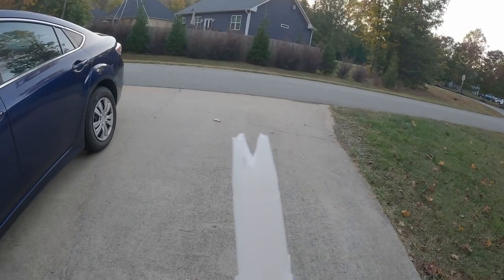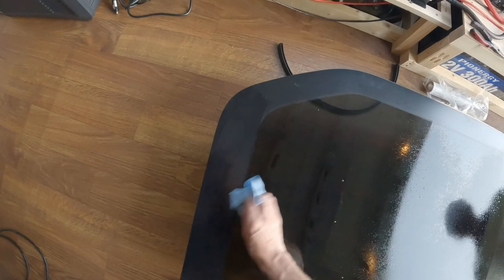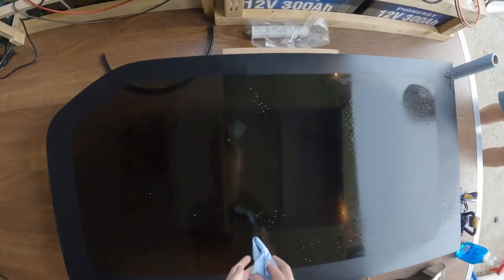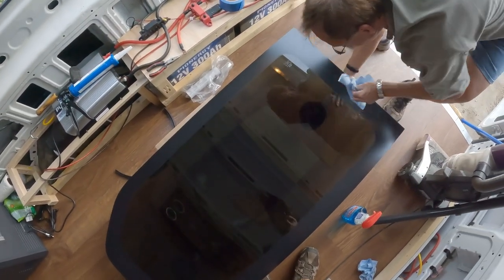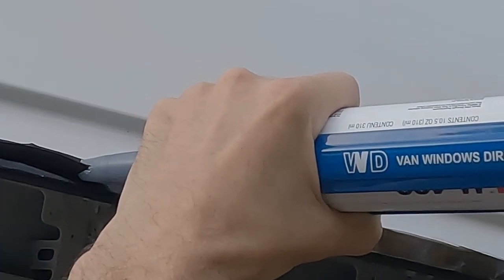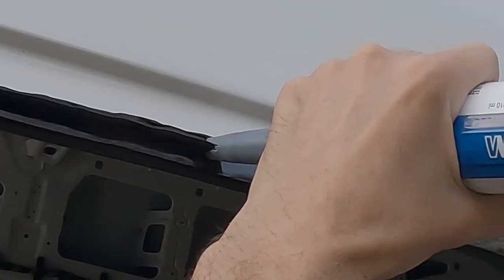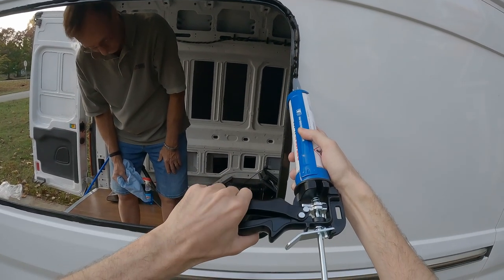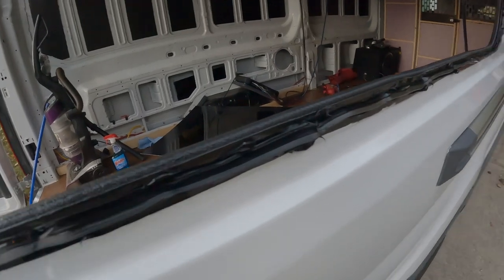With your bottle of urethane, cut the nozzle to look like this — it will come out properly and in the correct shape that professional installers use. Do a primary thorough clean of the inside of the glass before putting on any urethane. You won't want to take too much time between applying the urethane and pressing the glass into it. Press the suction cups onto the outside of the window now for later. Right over the edge, leaving just a tiny bit of room, use the urethane gun to squeeze a layer all the way around onto the primer. Try to make the line of urethane as constant as possible with no breaks. Start the line at the bottom for best results and go all the way over the top with one extended line without breaking.